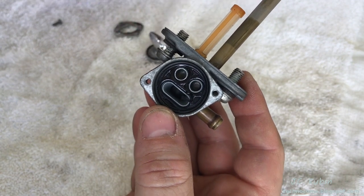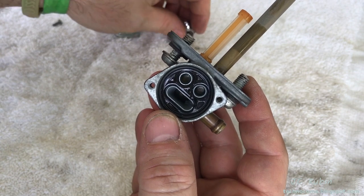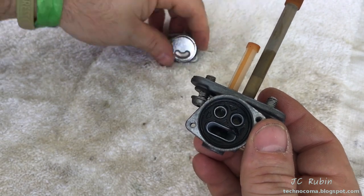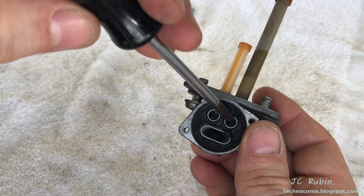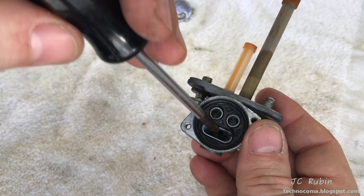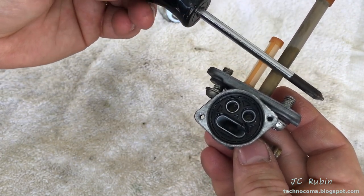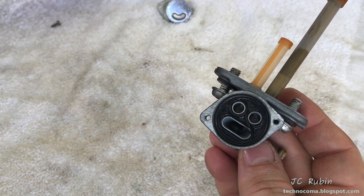This was the cause of failure — this is why it started leaking. It was coming through here and out the other side, so this is going to have to be replaced. In the off position, we can see the slot — a little smiley face here. In the off position, there would always be fuel trickling from the primary on position into here and out. So there would never be a way for it to be fully off until the gas got so low that you hit reserve. At that point it would stop flowing, so reserve would work and on would always be on.